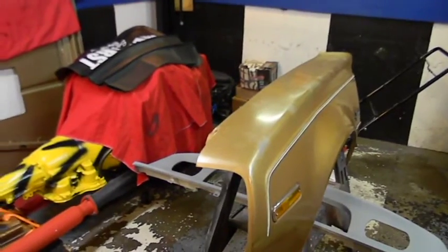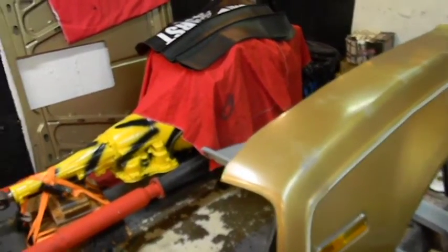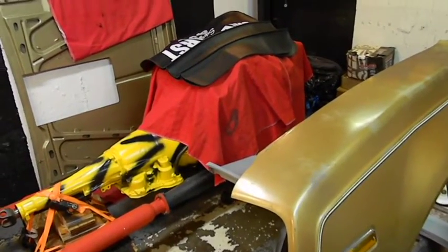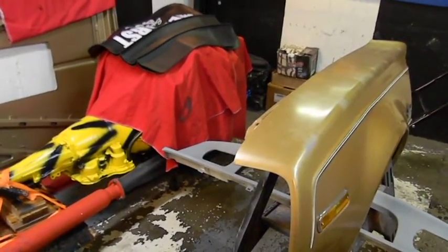I took the cross member to work, the old 6-cylinder one. I degreased it, so I want to get under there tonight, get the cross member on, and get the two lower control arms and the front tires on. You know, in the next day or so, we'll get the car in here. Then my job's going to start working on the fender. I want to put the fender where it belongs and adjust the door gap. And then he can start working on the door.